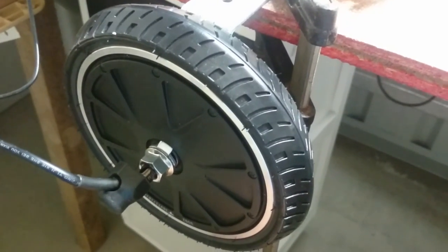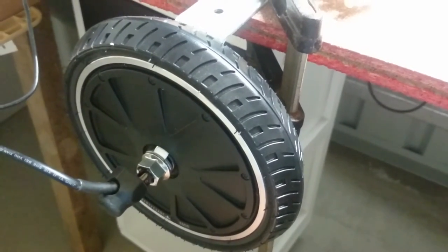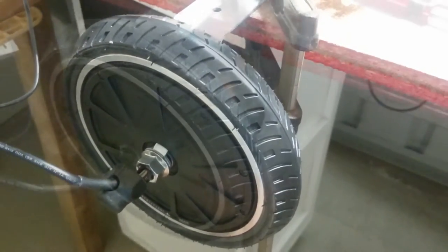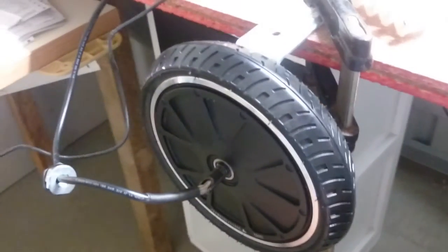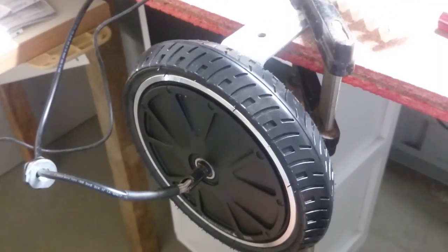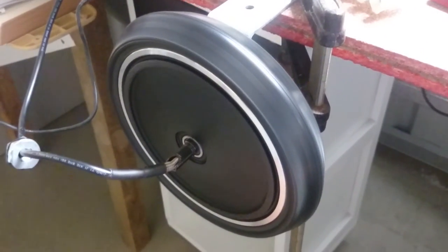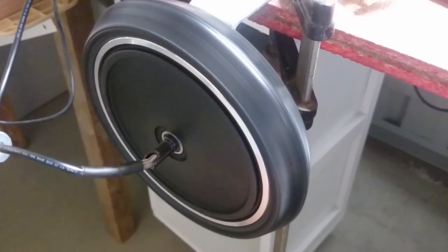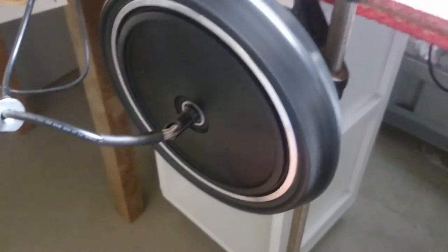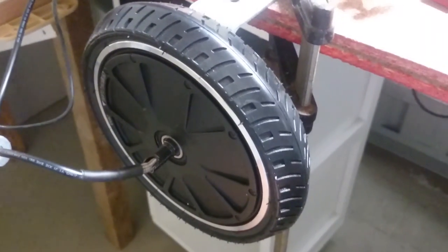It spins first try. I didn't even have to worry about going through the settings to recalibrate, so that worked quite well. I've just swapped a couple of the phase leads so it runs in the opposite direction, and I've removed the little washer so it doesn't tick anymore. It's actually very silent — it's not making a lot of noise at all. Once it's on the scooter, I don't think anyone will really notice that it's got a hub motor on it.